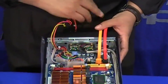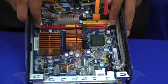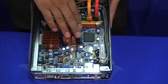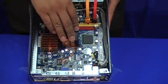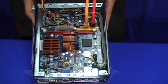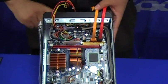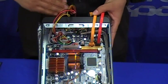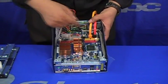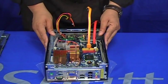For the optical drive, it also includes one memory slot which supports up to two gigs. This heatsink here is mounted on the Atom CPU, which is dual core, and this is the heatsink for the Intel 945GC chipset. There are some USB devices attached to the motherboard, and as you saw, the front panel has some audio and USB ports. Let's go ahead and assemble the rest of our components.